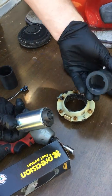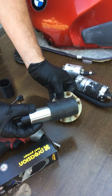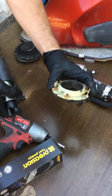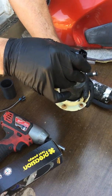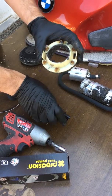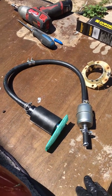To give you a little overview: we'll use this submersible sleeve, place our fuel pump in it, and then once the rubber membrane is gone we'll clip this plastic clip back into the fuel pump well and place the assembly in here with the strainer attached to the bottom. Let me clean it up and show you what it looks like when it's all done.